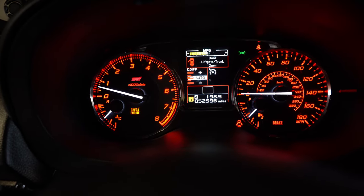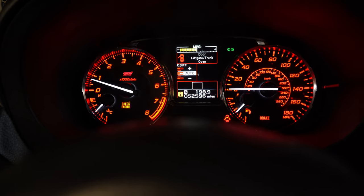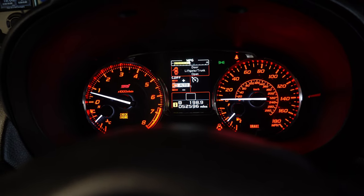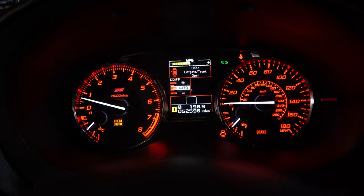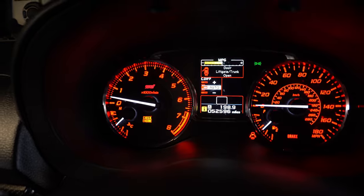The engine is holding on for a bit, but it's eating up all the remaining fuel. Eventually, with no fuel pressure left, it finally dies. Once it's dead, you want to make sure to undo the negative terminal so there's no issues, and that step is done.